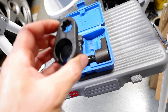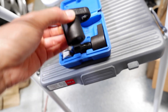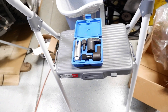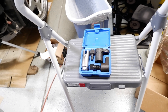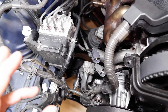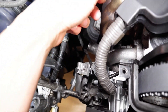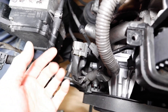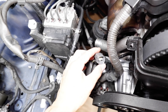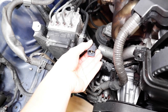It comes with a deeper one too, but that one uses a star bit which I don't have — I'd have to pick one up. Also that one is probably too long to fit against the firewall anyway. One of the first things you've got to do before you start taking it apart is unplug the O2s from the harness. Both the ones for Bank 1 are up here. There are two different type plugs so you can't really confuse them — one style on this side and a different style on the other side.